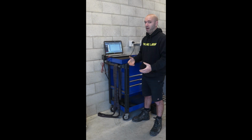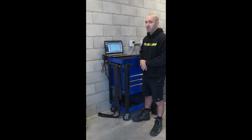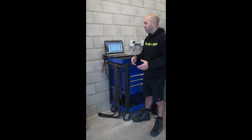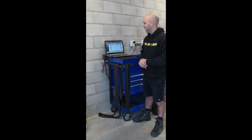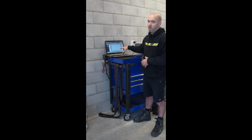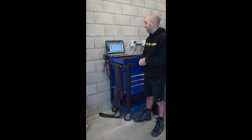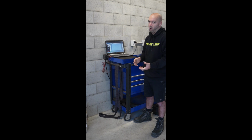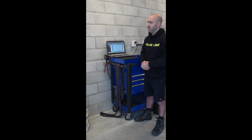We've made 1200 RPM more response. We've made the torque at a significant amount less boost, and at the moment we didn't actually get to finish the dyno on it because the load cell started playing up. So I think with a little bit of timing and just cleaning things up a little bit, this exact setup would probably make, at the same boost, if not more power and torque, and obviously that significant increase in response where we wanted it, between 3,000 and 5,000 RPM, is just going to be an absolute game changer.